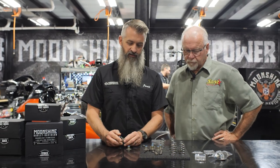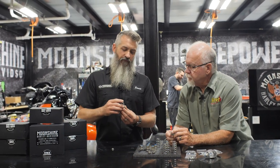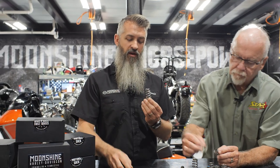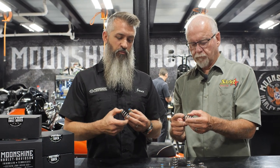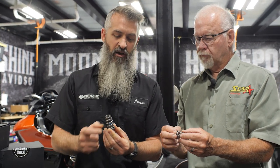If I was building a race motorcycle and wanted to win the world championship, I would use this style wire and this manufacturing process from PSI. This is made exclusively for us. Some of the things we've seen through the years on M8 springs is they're not fitting real tight on the bottom, so the spring is able to move around and walk while the vehicle is running under load — the springs rotate. The calmer we can keep the spring from moving around on the bottom and the top, the more stable it's going to be in an extreme environment. George has worked with the spring manufacturer to make sure the seats fit really tight, and the tolerances are a lot better than any we've ever installed.